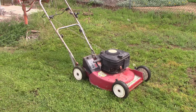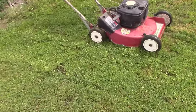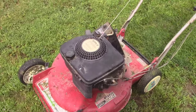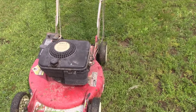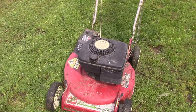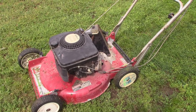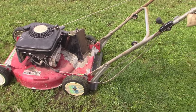Going to call her up and let her know that her mower is done. I hope you guys enjoyed this video. It's kind of interesting sometimes the amount of work you have to go through with these to get the carburetors working 100%. That's something you always want to check when it surges like that — all the linkages. You want to make sure those butterfly valves are opening as they should, no tension on them when there shouldn't be, and that they move freely as designed. When they start binding up like that they can cause a lot of issues, and unfortunately a lot of people throw their lawnmowers away because of that, even though it's just a simple fix. This lady's going to be happy that her lawnmower is done.